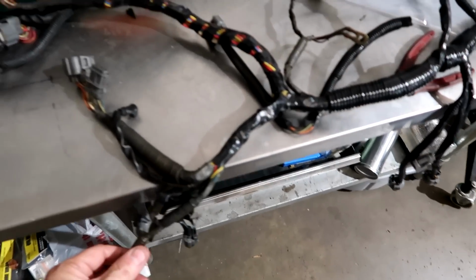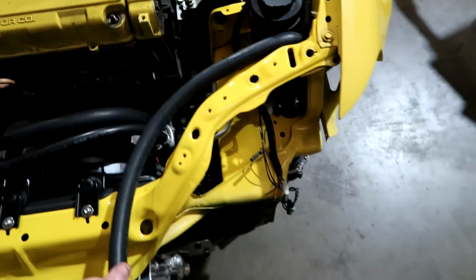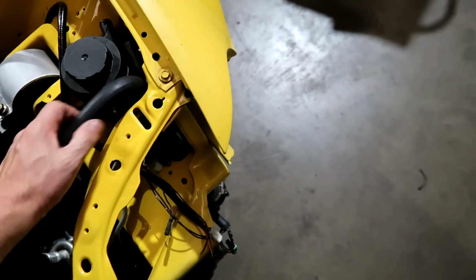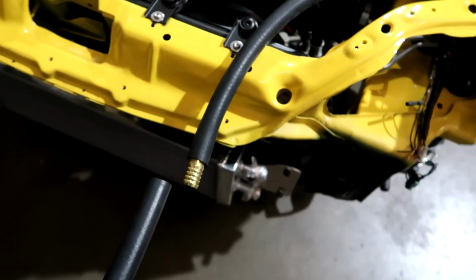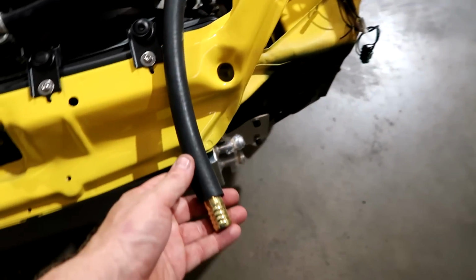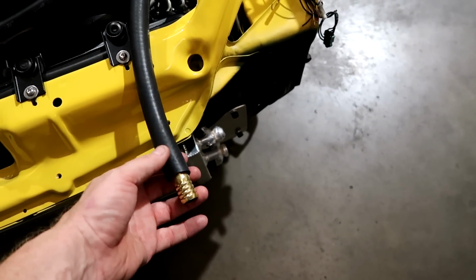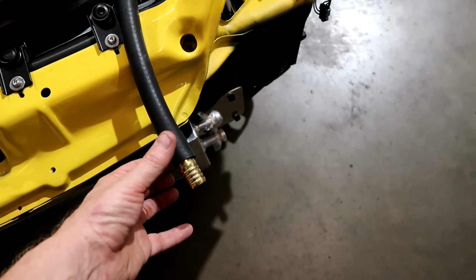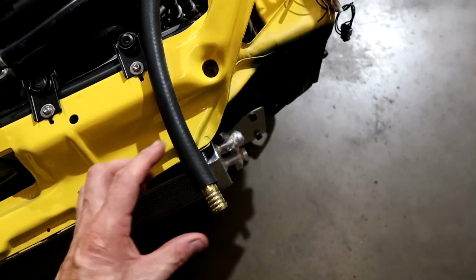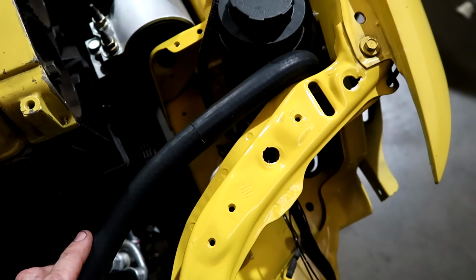As you see, we're working our way up this end right now. The supercharger belts and alternator belt is situated. The hoses we're using are molded, and I like to do this, or we like to do it. That one's already in there. But you can join straights to molded bends like this, use the inline connectors, and then what we would do here is you can buy the heat shrink for radiator hoses all the way down to heater hose size, which this is 3/4 ID, and it's basically a sleeve that slides on here. You heat it up, it shrinks down here. It's much cleaner than a hose clamp. Like here, this is a real nice seam. You put the heat shrink over here, much nicer finished piece.